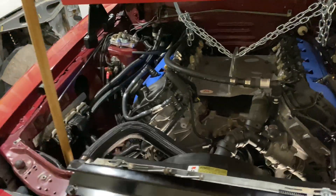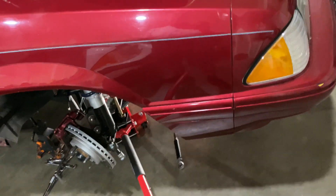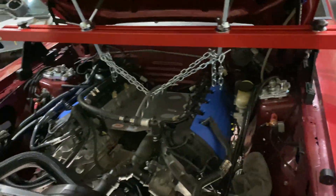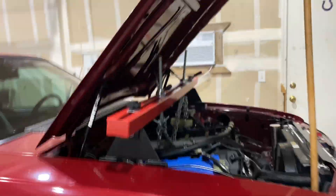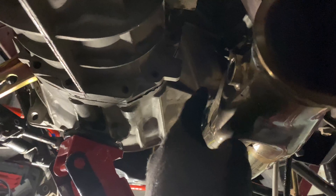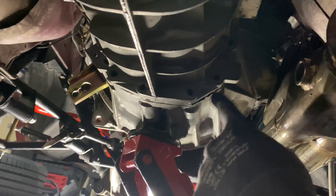My plan is to lower it down a bit, get all the bolts off the bell housing, and hopefully pull the transmission out. The only thing my buddy Robbie was telling me — he showed me a picture of one that was already out — hopefully this tube right here doesn't get too much in the way of the bell housing. I don't have a header on this side so I think I can loosen them up. Hopefully I'll be able to pull the transmission back far enough to clear the input shaft and get it out of that tube.